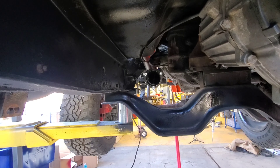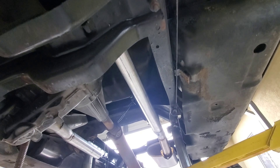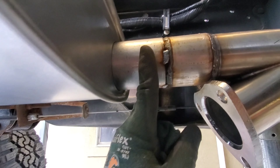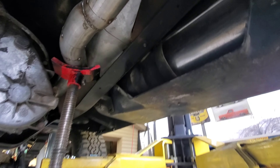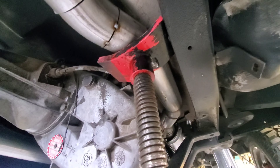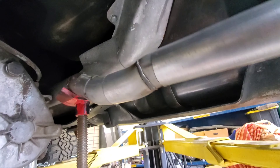This one I'm gonna just run straight, but we'll go ahead and see what we can come up with and bend this. Alright guys, I got this side all kind of put together and welded in - it's pretty self-explanatory, that's a straight shot. I put the cutouts here and threw some paint on there last night, got the muffler just tacked in. I still want to use a muffler clamp because I don't want to weld it all the way on in case I don't like these mufflers. I still got to finish the back - this side's been a little more complicated. I've got a bunch of pieces tacked in to go around this transfer case; it's a tight little bend but I think it should work out really well.